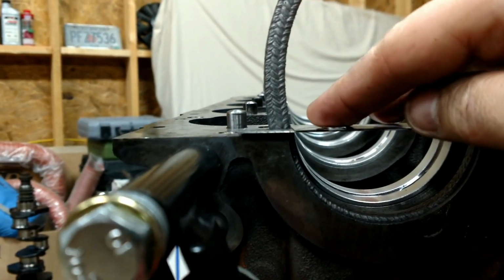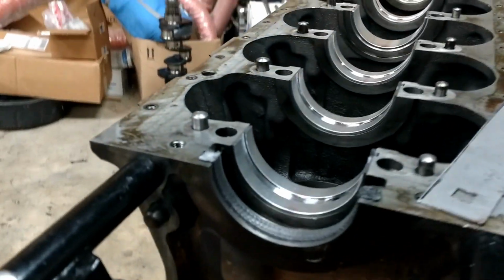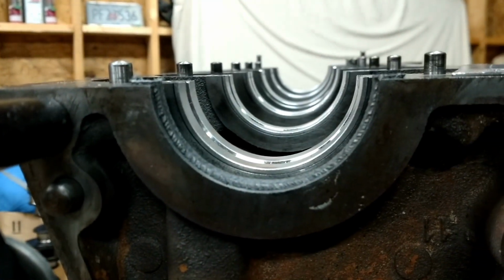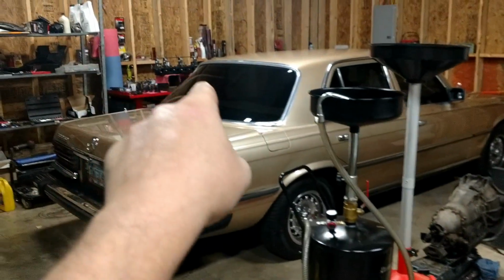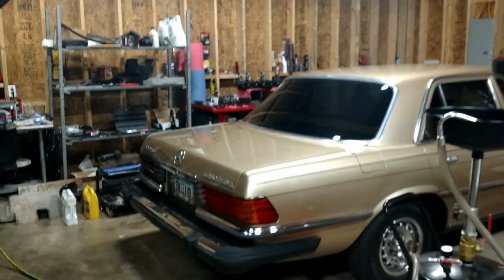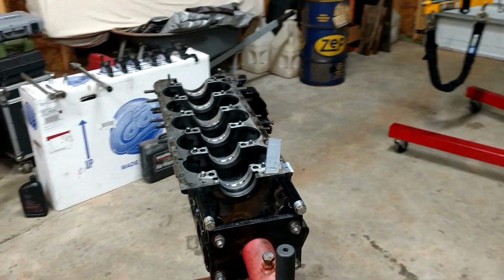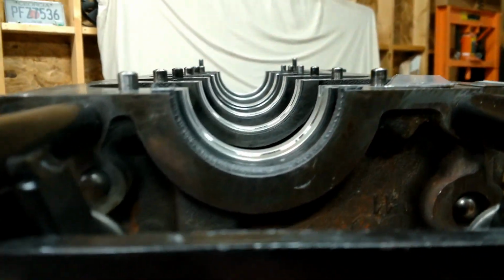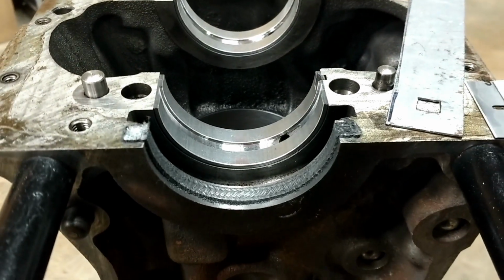All I'm going to do is go up there and start sawing across there. That's how you do it. When you have the right tool, it works absolutely perfect. So with this tool and then the flapper wheel that I showed you, and then that front seal tool, I put that seal in 4 minutes, and it's done and it's perfect. You can see how everything's exactly 1 millimeter above the block, and they both have perfect cuts on them.